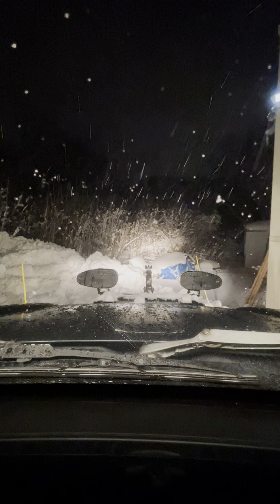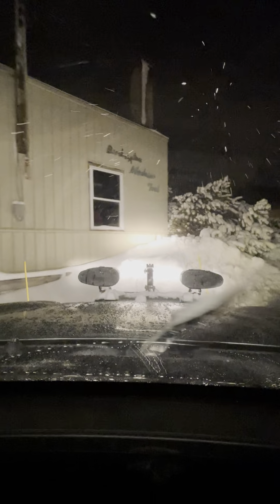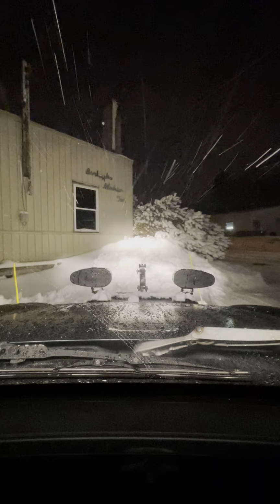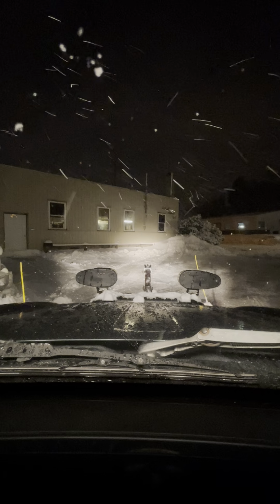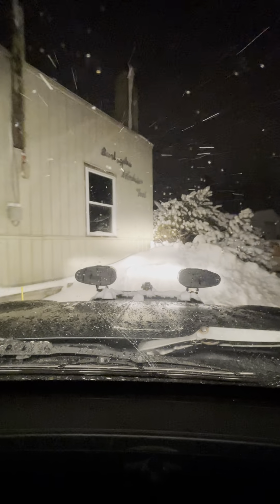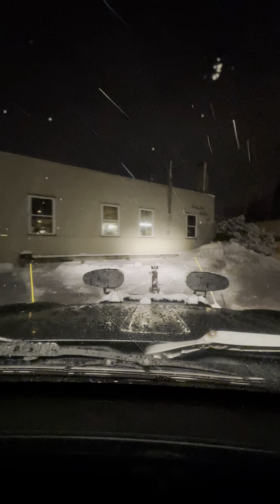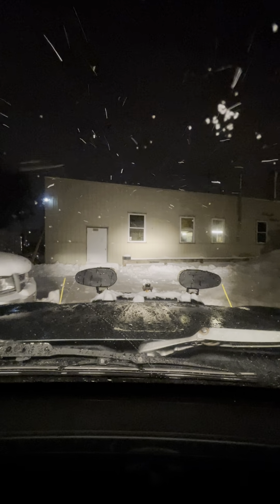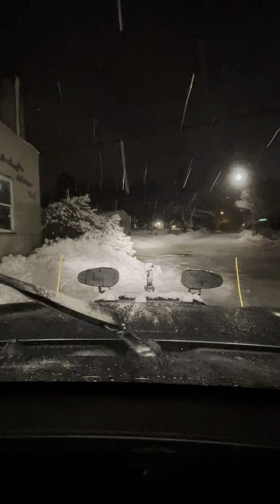Remember, I just got new tires today. They're a little oversized. I've got 2.5 inch budget boost with iron rock upper arms, all new ball joints, suspension, etc. I'm putting Old Man Emu 3.5 inch heavy duty springs in it this week with Bilstein struts and shocks. That'll give me the clearance so that I don't rub lock to lock. I already beat the pinch welds today when I put the new tires on.